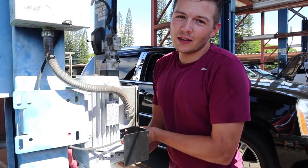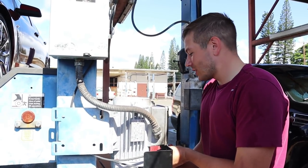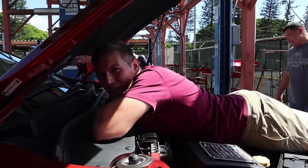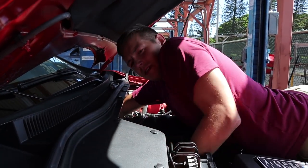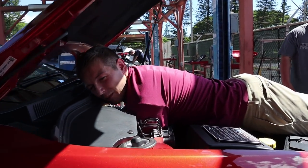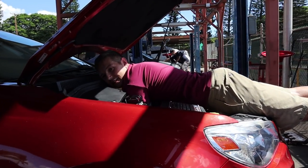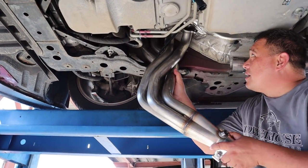Now we're going to drop the car, put the extensions on — it's going to make it a lot easier. We can do everything from the bottom: hook up the O2 sensors to the headers and then bolt it in. Just want to make sure you understand you're going to get a little intimate with your car. This is what I call the superman pose — the car really likes it and it's the best way to get this on.